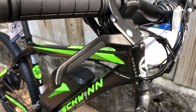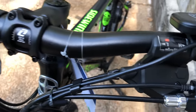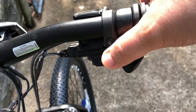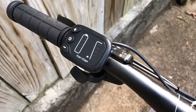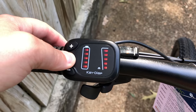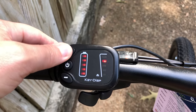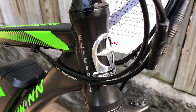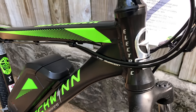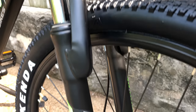The handlebar grips are very standard. The brake levers are plastic, though they have an integrated rubber textured area that makes them feel slightly higher spec than they probably are. The shifters are MicroShift trigger shifters — the right is a seven-speed index shifter, but the left looks like an index and actually isn't, and I don't like that. Computer-wise, they went no-frills — very basic yet functional. There are five pedal assist modes and it's easy to work up and down through whatever mode you want.